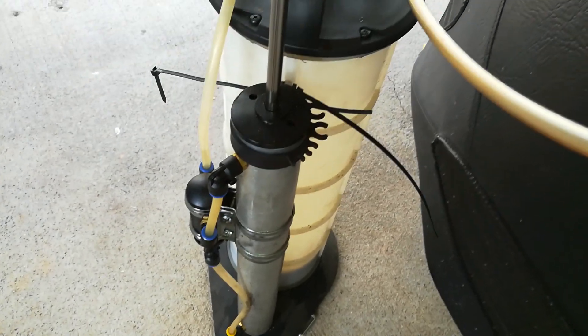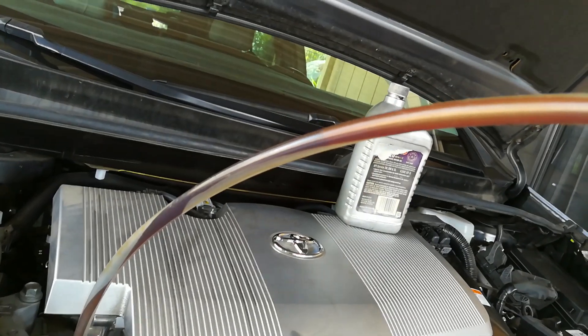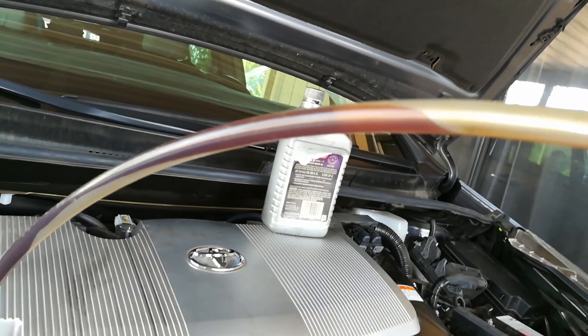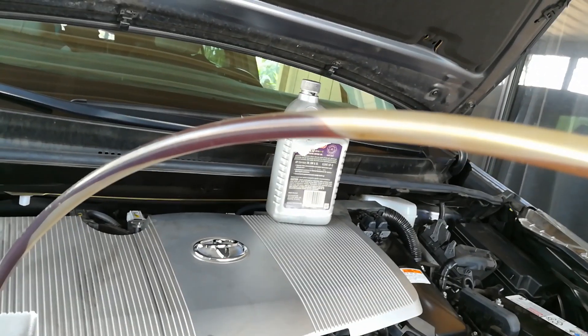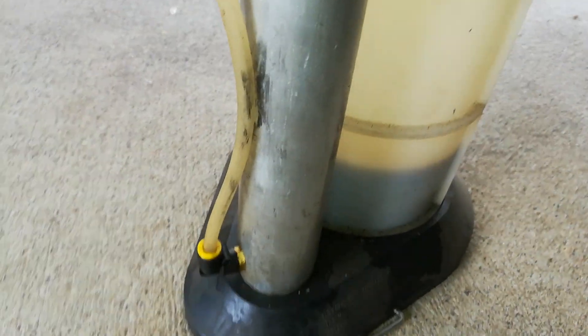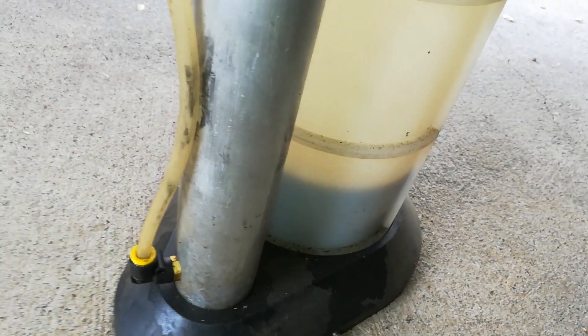You just insert it and now you come back to your suction machine and you can suck the oil out of the car. You can see that the oil is coming up right there, and now I just get to the point where I suck out how much motor oil I think is excessive — so if it looked like it was a quart too much, I would just suck out that quart.